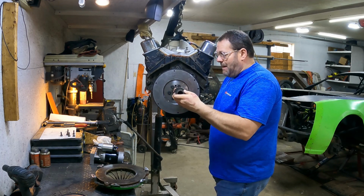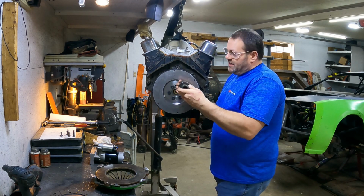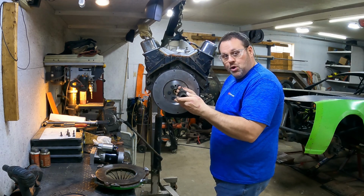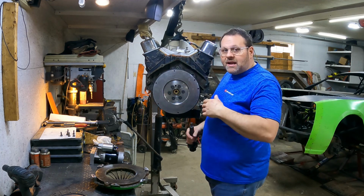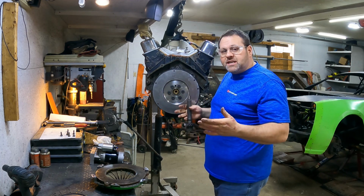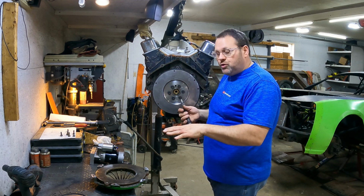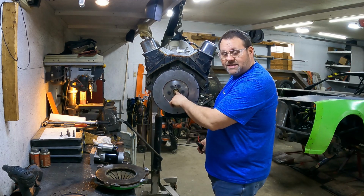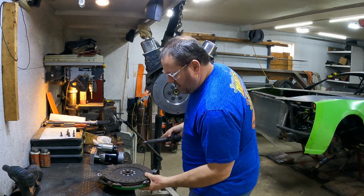And eventually what will happen is the front of the shaft of your transmission will start orbiting like this. It'll start walking around some and moving. That's going to create premature failure. It's not going to happen immediately, but you're just going to have overall shorter lives on your transmission and on your clutch, and you'll see that when you pull this out, this bushing is just going to look like a disaster. Pressure plate side down onto it for the clutch.